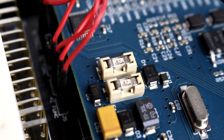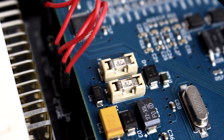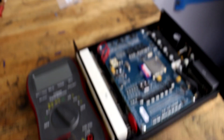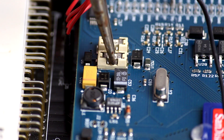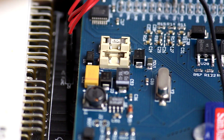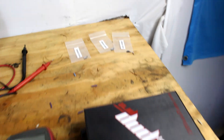First I'll show you how to replace that fuse, then the process to safely get everything hooked back up. To buy the right fuses, go to DIYautotune.com — that's who builds Megasquirt. Make sure you get the right type; mine are 500 milliamp. There are different types etched on them, so get the correct ones — I'll link them below. Remove the old one — look at that little troublemaker — and put in the new one. New fuse tested good!